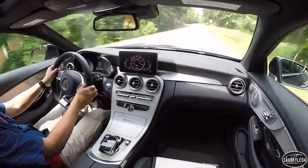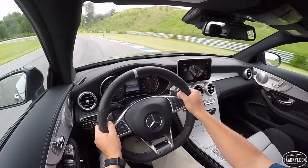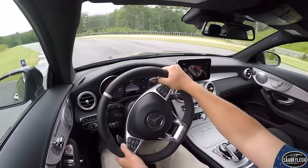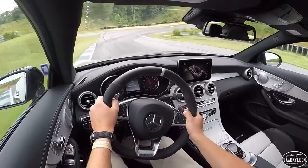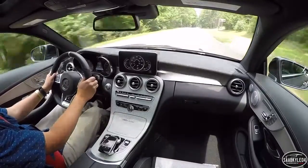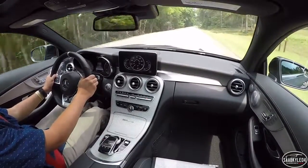Its response, especially in the more aggressive drive modes, is very comparable to a dual-clutch transmission. Shifts come on with authority and plenty of drama when you opt for the performance exhaust system. In fact, when placing the car into sport mode, the shift points are raised while shift times are reduced by 30%. Sport Plus, Race, and Manual modes offer lightning-quick 100-millisecond upshifts along with rev-matching downshifts.